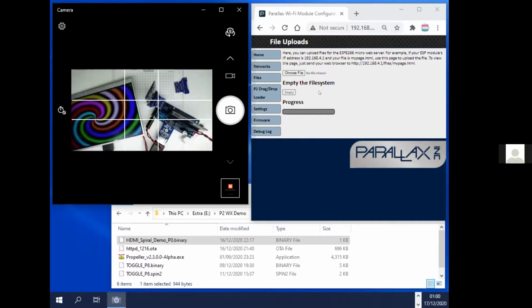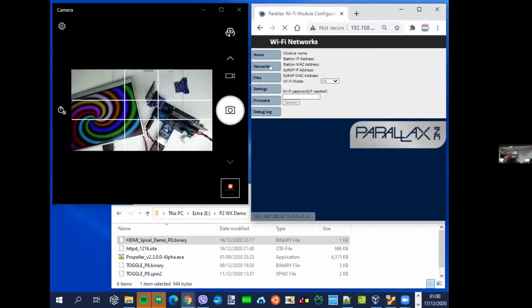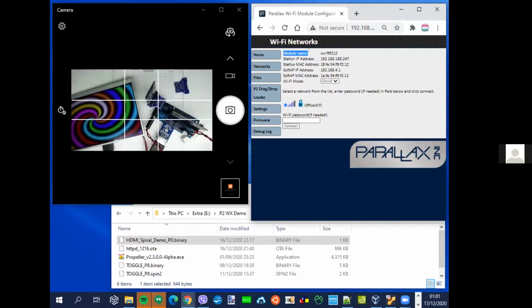Ken, was your question answered? I think so, yeah. How would somebody access this remotely? And they would just need an IP address to type in? Is that correct? Yeah. And well, then your router would have to accept me. Yeah, you're talking about setting it up so that it shows up on the net and it's accessible from a really remote location, for example, right? Somewhere other than Michael's living room. Yeah, so what you'd have to do is the router on the subnet that it's connected to would have to be one that you can configure to support port forwarding. Mm-hmm. And then you come up with a port number, and you know, configure the router for that. And then from whatever location you're at, you use the IP address of your internet side of your router plus that port number.